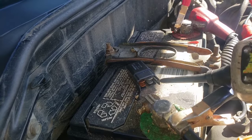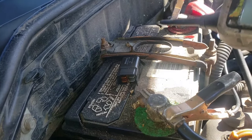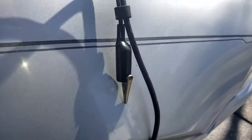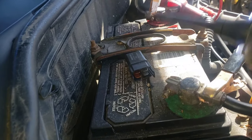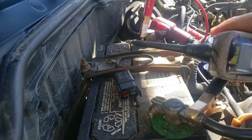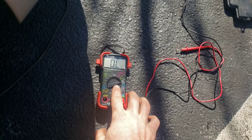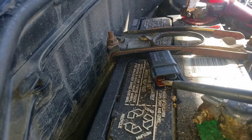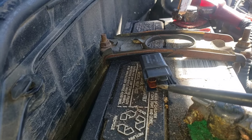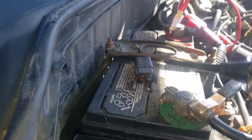I have a separate video showing how to check any relay — just search 'fix book check relay.' But here's the quick method: take a power probe, hook the negative alligator clip to one of the control side pins, and power the other control pin — it will click. While that's in place, take a digital multimeter set to ohms and check resistance on the two high-power pins. You want very low resistance — like zero or 0.1 ohms. If you see 90, 100, or 200 ohms, there's a problem inside the relay.